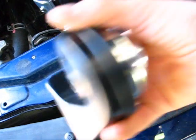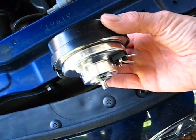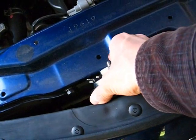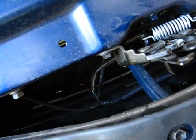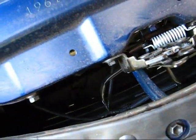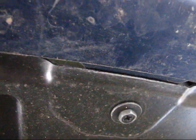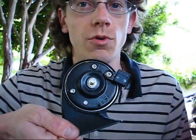I've got myself a little problem. This one's a little bigger, and there is not enough space to get it in the way I took out the other ones. So I'm going to have to remove the splash panel underneath in order to feed them from below — looks like that's the only way. Underneath here, I've got to loosen that nut, and that one, so I can get above this thing. This new horn has two terminals, and the old one only had one terminal.